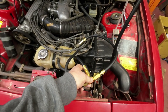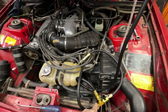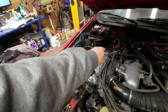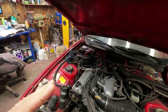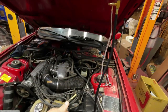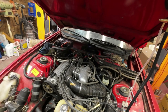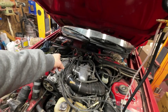So this pipe here comes off the fuel regulator, right, into the pressure gauge, and that closes it there, so that stops it from going to the warm-up regulator, which is way over in behind there. Now I want to check number one, fuel system pressure, which would be get the pump going and this stuff just the way it is, right? The next thing I want to check is fuel pressure with the system cold, which would be with no electricity to that thing.